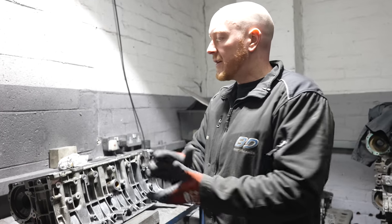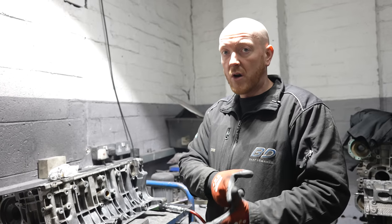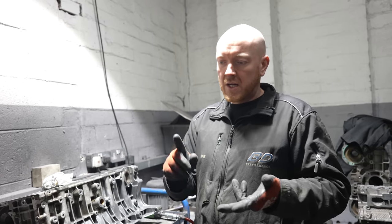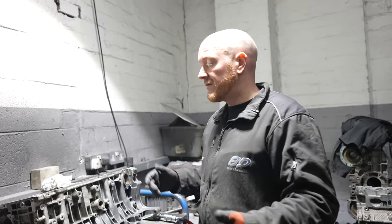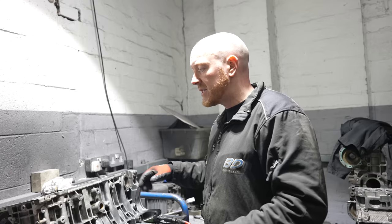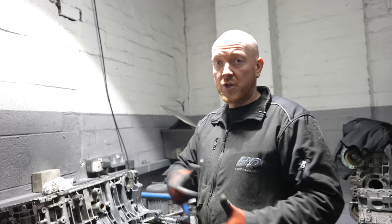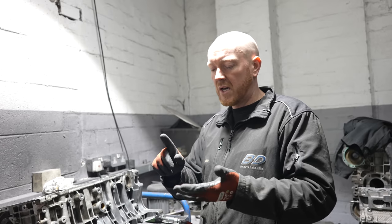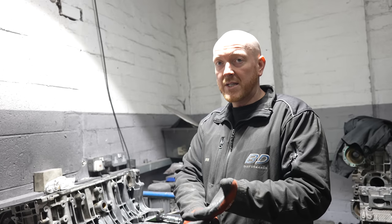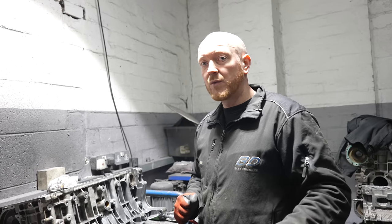Then, obviously, RS Turbo, which is a brand new off-the-shelf unit that we use in the package every time, including the oil feed, return, and the relevant silicone hoses to join into the existing hot side boost pipe. And then you've got the RS crossover, RS MAP sensor, MAF sensor, the wiring needed to convert to RS MAF, and we clone the ECU over onto base RS software.